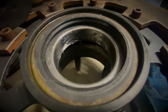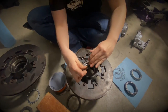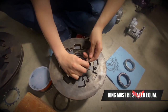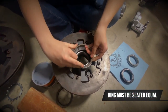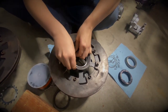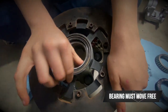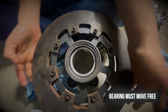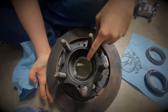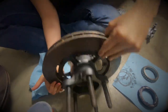If you look in there you can see the groove for the ring. Slowly feed this in and just work your way around putting it on the inside. Very important - you want to make sure that the bearing moves freely like it does now. If it doesn't, you got to flip this thing around and then just tap the bearing so it pushes up against the retaining ring, and then it'll start moving free.